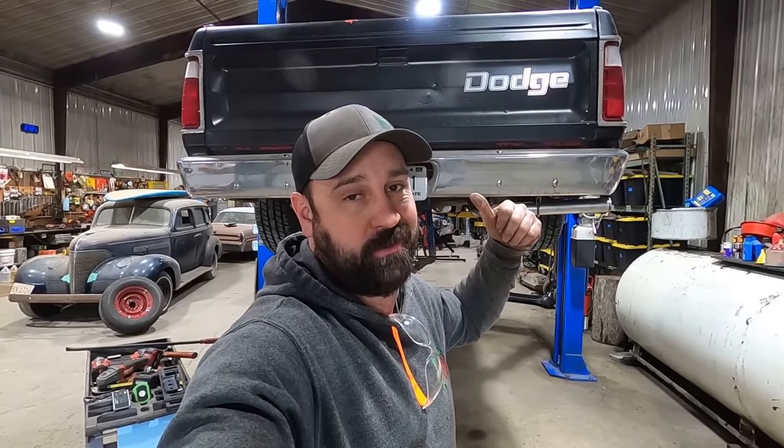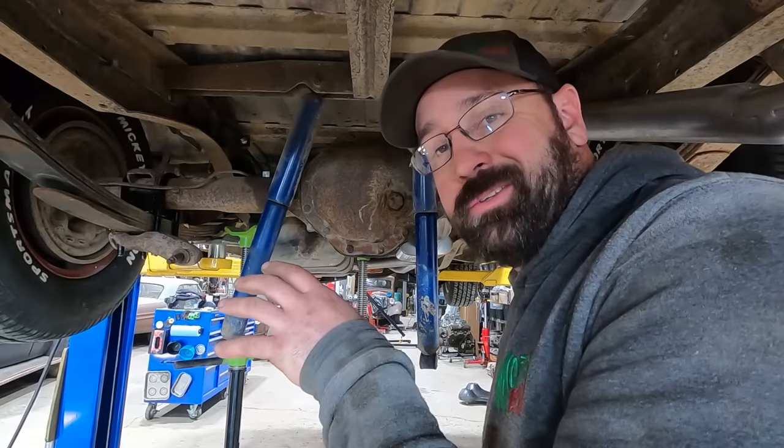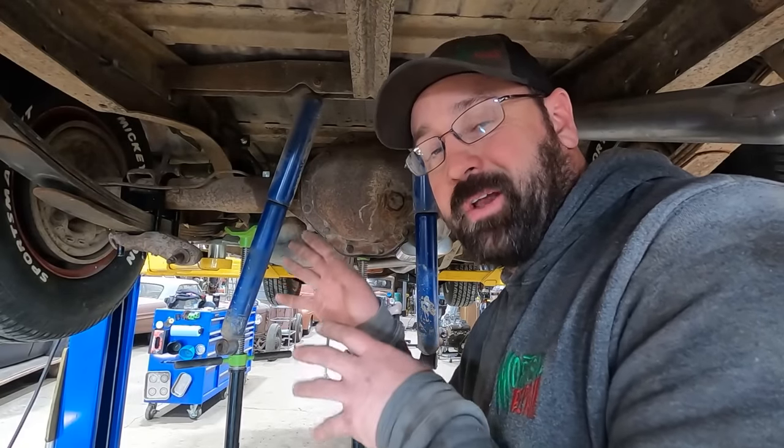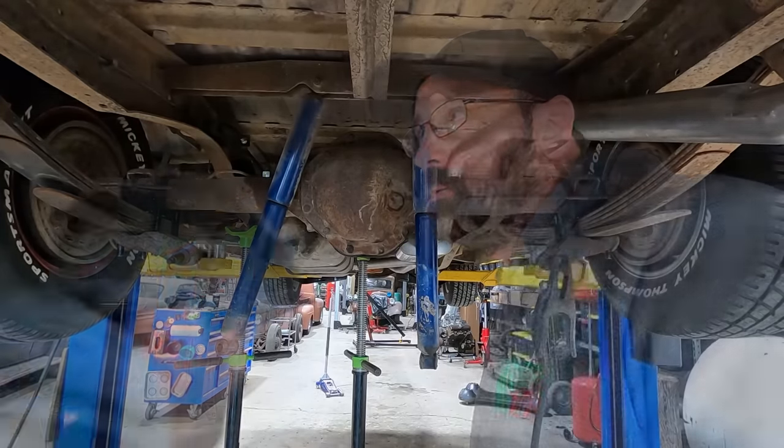So I'm gonna grab the welder. Tack it in, probably not burn it in, just tack it in, suck it down, all good. We could probably suck it down right where it's at. Then I'll recheck it, and then weld it, so it's not moving in the meanwhile. Good idea. The U-bolts are all clamped in place, double check, we're still at 5 degrees, so we're gonna get the old Miller 200 out and burn her in a couple spots. It should be ready to go, I think.